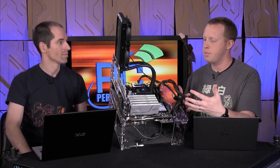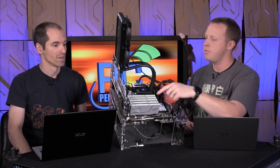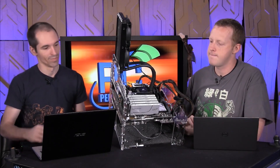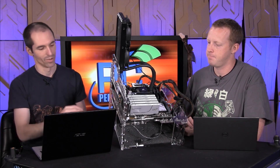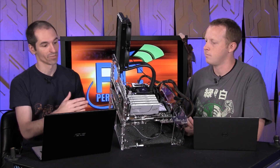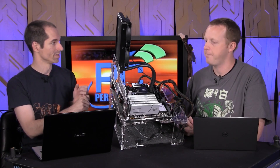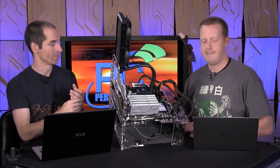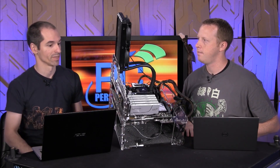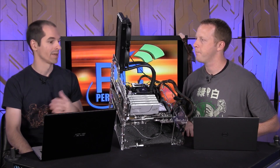Because this is an enthusiast-class motherboard, most people are going to have two-slot graphics cards, so that second slot is almost never going to be used. ASUS probably just gave them an extra slot in case they need it for something. But because of the way that links, you have the DMI bridge which has latency since you're not connecting directly to the CPU. And the DMI output to that slot is only PCIe 2.0 x4, so it's a little bit slower and has more latency.